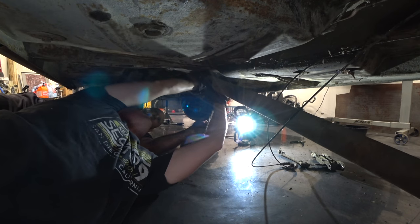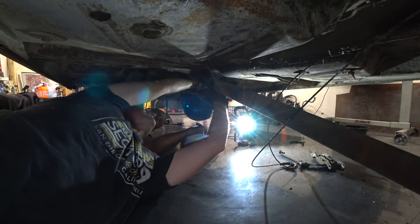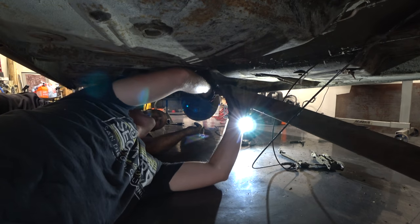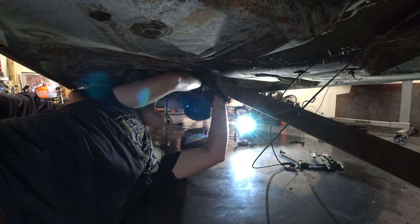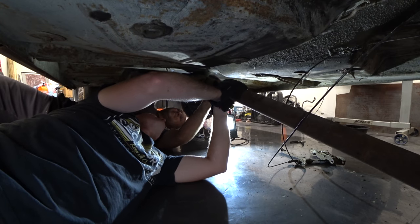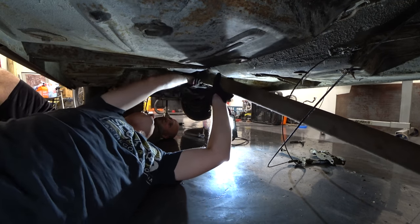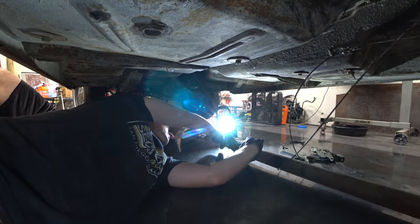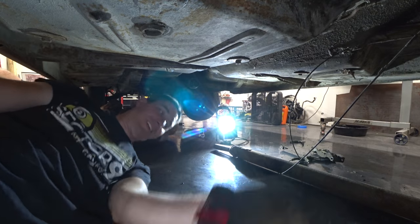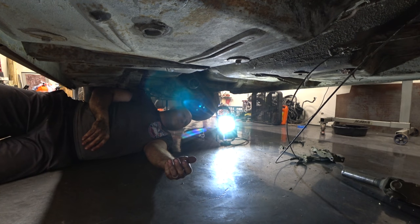Just tell me it fits. Don't fit. Just kidding. Early cars are 24 spline, the later cars are 26 spline. I thought you were just making up a spline count. I did a little bit of research. It is turning the transmission — you can feel the splines trying to grab. I think we're going to have to get a different yoke. On the upside, Ford made like a hundred million of those transmissions. On the downside, I just repacked that U joint for no reason. This other drive shaft back here — that's a big boy. If nothing else, we could probably swap the yoke.